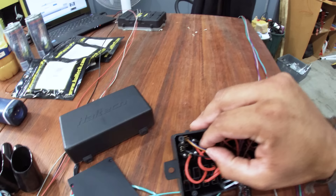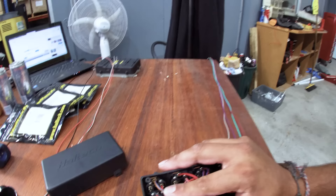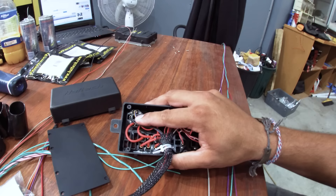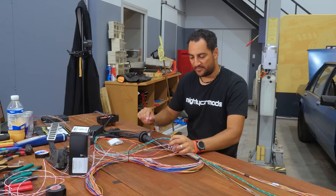As I mentioned in a previous video, I'm actually going to run the fuel pumps all the way to the back of the car, so I'm not going to run this powered wire — it'd be about five or six metres. Instead, I'm going to run a new trigger wire from the ECU connectors to the back of the car, and use this wire to do our starter motor. We did have a few problems with the ignition barrel, so we're going to use this one to do the starter through a button.